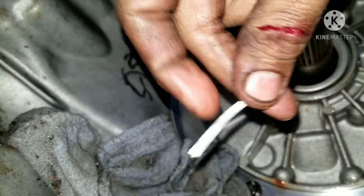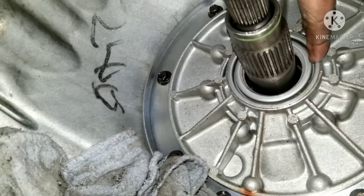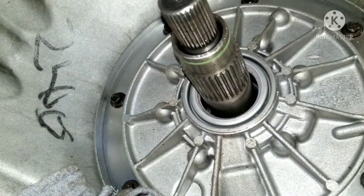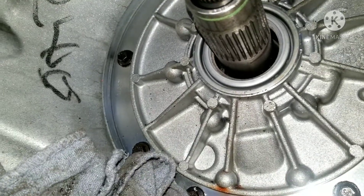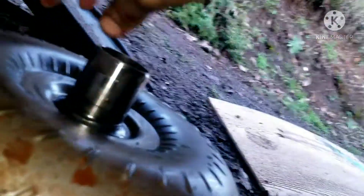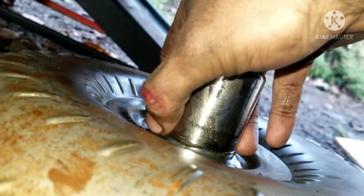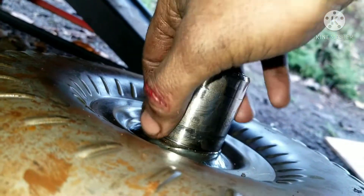This is part of the bushing — part of your pump housing. This is a pretty common problem as the bushings wear out on the torque converter, as you can see down here. It doesn't feel like there's anything, but it's really sharp and weird feeling.